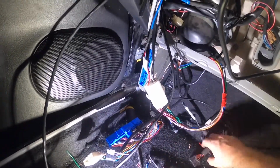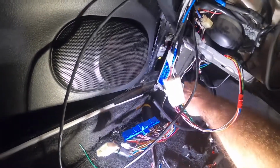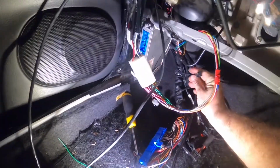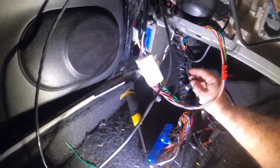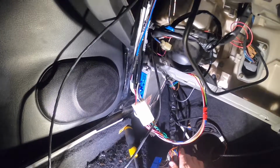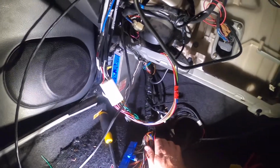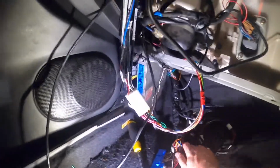And then I got my wideband controller going here, which is off the CAN, which I've wired up out of the CAN off the old Haltech one, and it should work. Don't know if it will, hopefully it does. So I've just been fitting that off, and then I'm gonna see if I can plug it on and see if the computer can pick up the sensors, and hopefully all's good for the tune next week.